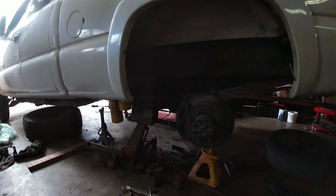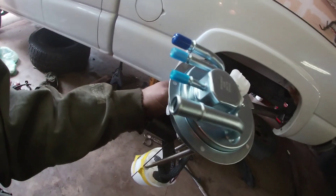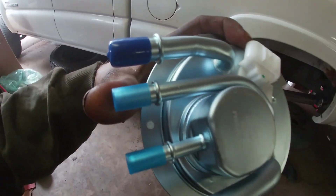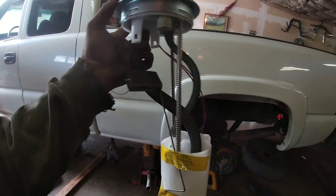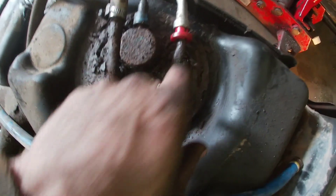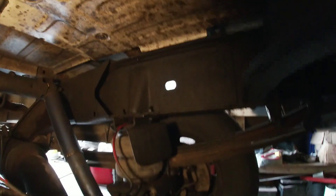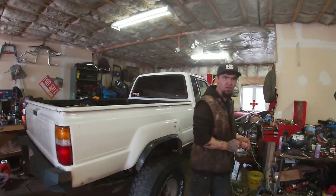So this thing had the original stuff in it. We're going to install this new sending unit that we got here — you guys can see. Calvin hooked me up and went and got me this. I'll open this up and show you guys the process of putting it in the tank. Yeah, this is a nice little piece here. That's the whole thing. This second one over is the one that's leaking right now. Oh, your fuel gauge is gonna work now — hopefully. Well, unless it's a cluster, because it's a GM. GM cluster problems. We're gonna put this new sending unit in. We just got my tank dropped — you guys can see she's seen better days. The truck is from Alberta, it's all original here. The frame's all in good shape. We're gonna put the new sending unit in this. Chad, I think you got yours working, eh? Yeah, get it working for now — that'll be good until his parts come in.